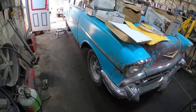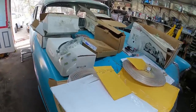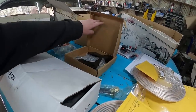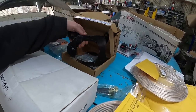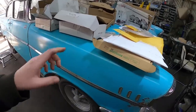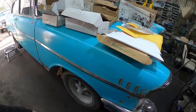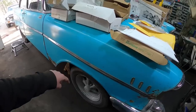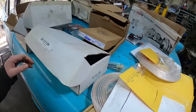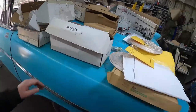I'm gonna pull the wheels, get this stuff kind of organized, start pulling the master cylinder off and the whole front end apart because that's gonna have to change, and start fitting this together. The other kit I did was really easy. The only thing was on the other kit I had - a no-name one on the 55 - the brackets had the calipers on the front which is a little weird, so I had to weld on tabs. And I had to drill the spindles for the cotter pin, which was also a nightmare drilling that hardened spindle. I'm hoping this kit's a little more thought out.